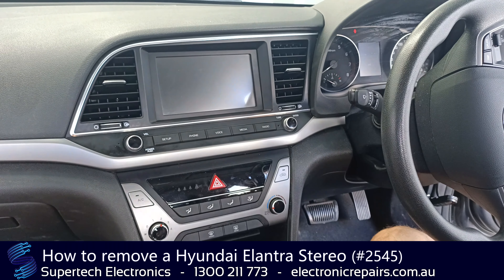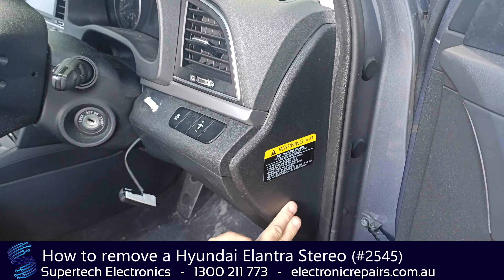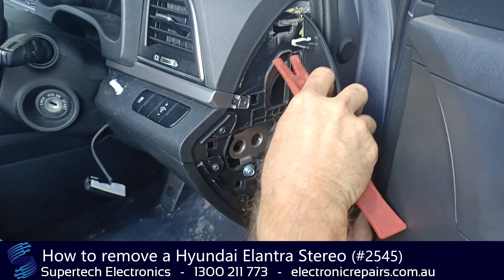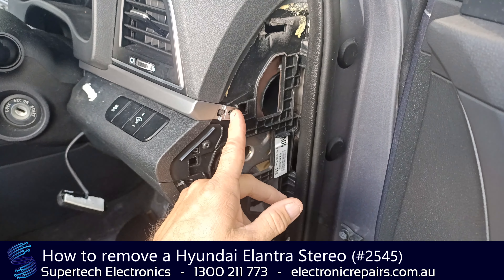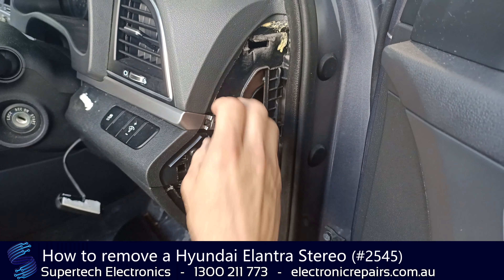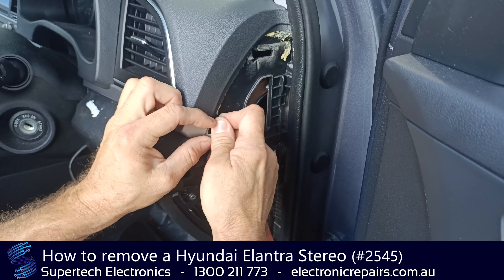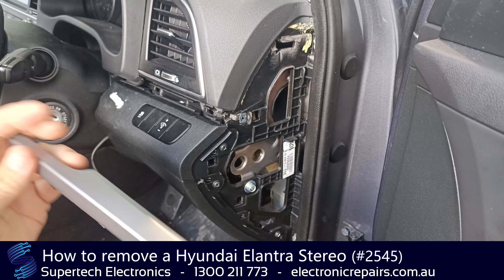Let's get started. We're going to start over in this neck of the woods first. We're going to remove this plastic shield here first — get your plastic spudger in and just wedge it out, fold it back and get it out of the way. Now that will expose one screw there. Just that one screw there, and we're going to peel this little strip back like so, and that will unclip.